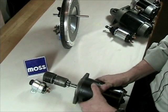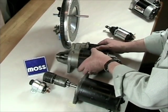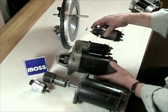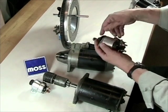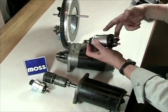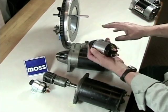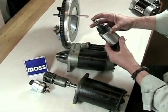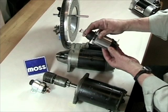So this starter was replaced with what's referred to as a pre-engaged starter, and I have a sample of one right here. The pre-engaged starter solenoid is mounted right here on top. At this end it looks the same — we've got an input stud, an output stud, and a small terminal going up to the cockpit. Inside we're going to have an electromagnet which is going to pull over and pull these contacts together and send power to the motor. The other end is what's different — it has this long assembly which also gets pulled in with the electromagnet.